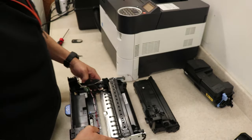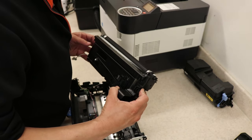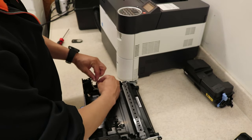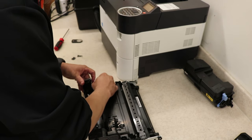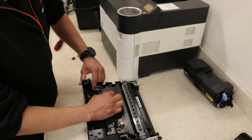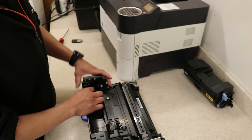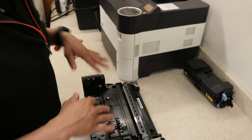Looks really good. For the developing unit that's still good, make sure it's not too dirty. Slide it into its grooves and snap it back down, lining up your cable correctly. Press down gently — there's a board here that's pretty sensitive, so try not to be too rough. Slide this plate in and make sure your wires are out of the way.